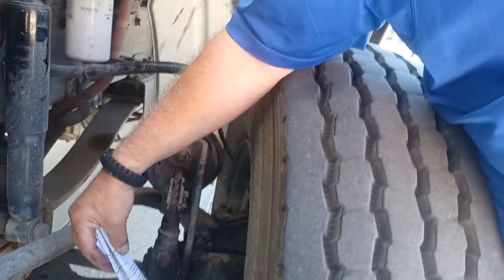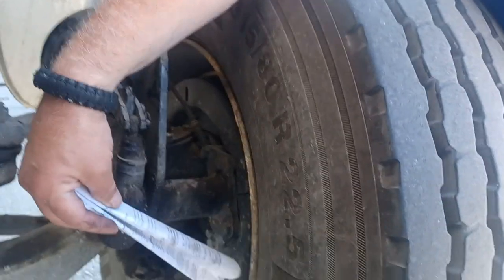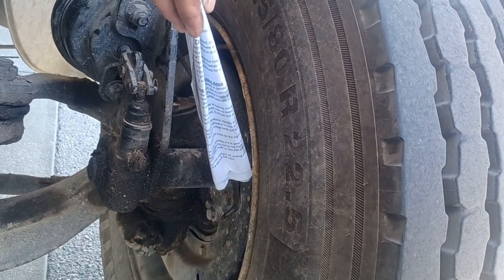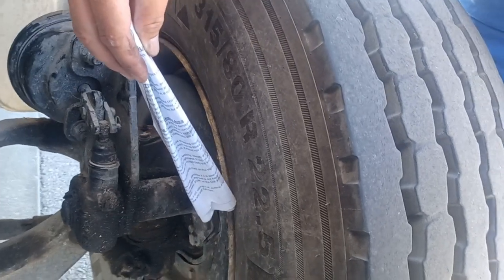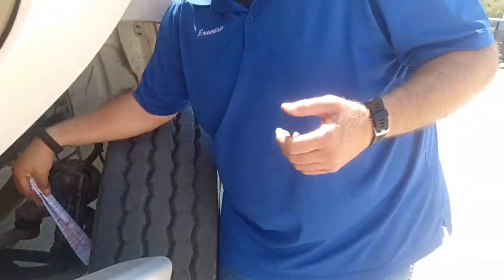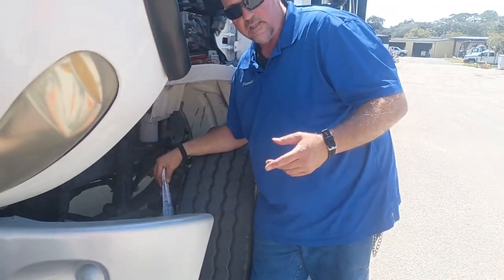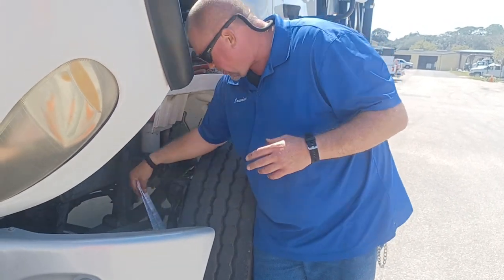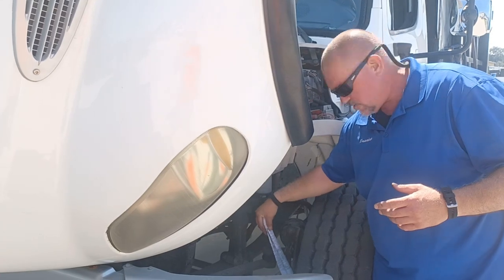Moving our way in to where the brake drum and the brake liner is — the brake drum should be free of oil, grease, and debris. It should not be heated up, so there's no bluing and no cracks on it. There's no debris in there, no grease, oil, or debris. Neither with the brake pads — the brake liners. They're not cracked and they're properly mounted with springs and fittings inside the brake drum.